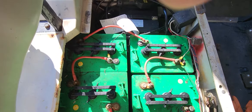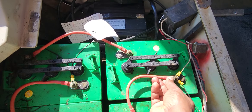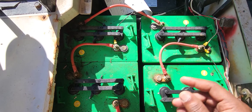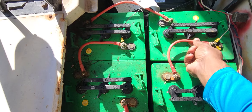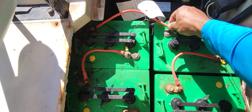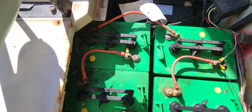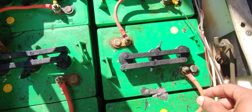When it comes to golf carts, the biggest thing you want to check is the terminals on the battery. Just take your finger — probably better to wear gloves because sometimes there can be battery acid — and just feel these wires. They're supposed to be pretty tight. You want them to be tight. If they're loose, that's not good. That one is getting a little loose. When they get loose, it means the eyelet is starting to corrode so much that it has worn thin and is going to break off. So just go to each one and check them.